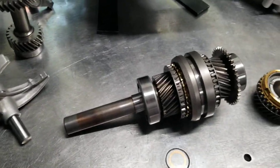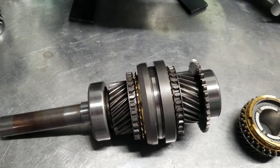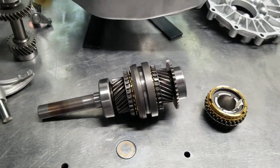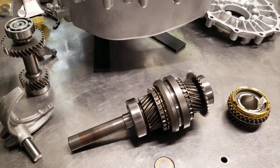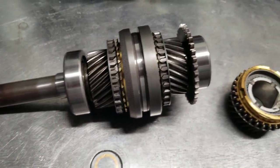The reason I'm making a video today is this one came in locked in reverse. We've all heard of the fairly common Club Car problem where if somebody aggressively selects forward or reverse, they can jam a synchro ring onto the gear. But in this case it was because of something entirely different, and I just wanted to cover it quickly. It's something to be mindful of.